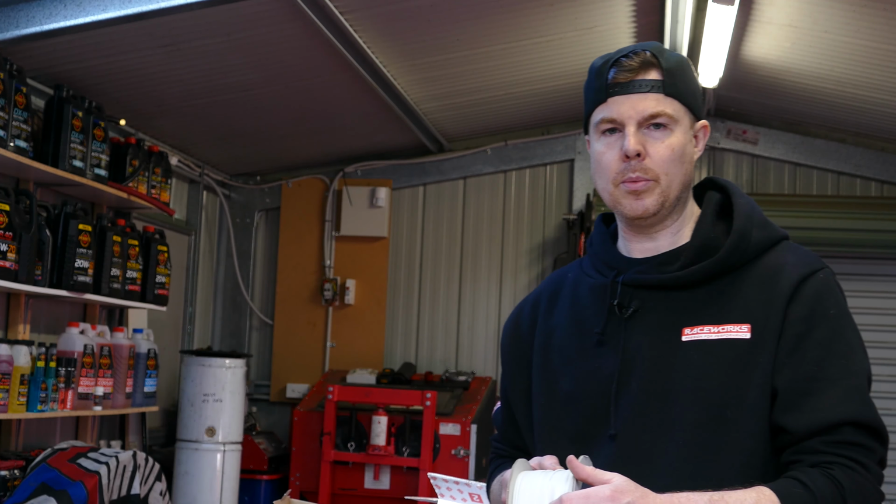And this is the stuff for 12 gauge wire, 14 gauge wire, where you have big current demand: fuel pumps, big thermofans, electric water pumps and things like that. Where the current demand's high, this is what you're going to want to use. As you can see, this is the pin, but unlike those other pins where the terminals fold over and crimp on, this is just an open hole basically. So how do you get wire into here, and then how do you crimp it down to make a positive seal? Well, let's run through that now.